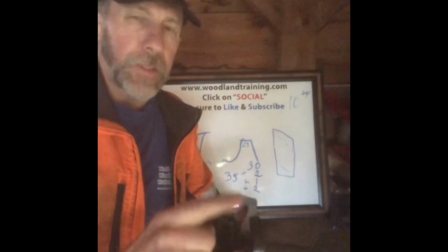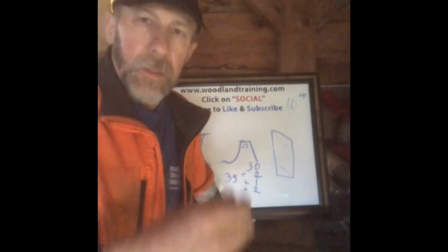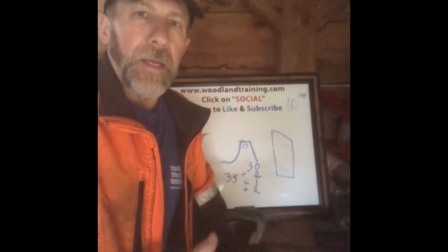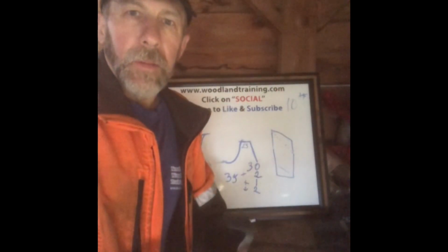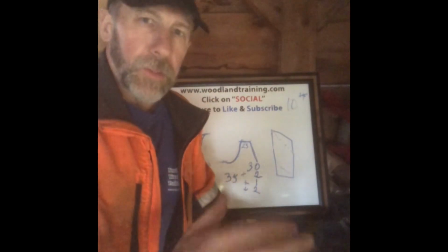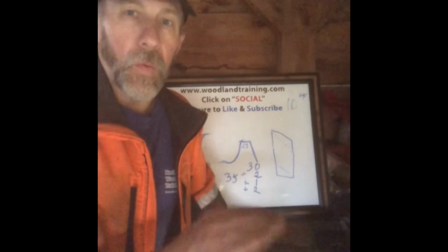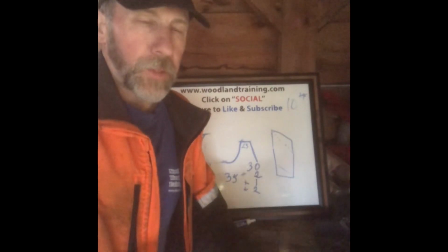So there's a lot of different designs of depth gauges. You know, this is your basic old style. I've got the model here. You've probably seen some of this chain. It's a Vanguard style. There's the double depth gauges and ramped depth gauges. All of that is designed to reduce the power of a kickback. The chain manufacturers, their company lawyers, are just deathly afraid of a lawsuit coming from a kickback caused by their product. So they're trying to use some of these features to reduce the potential of a bad kickback. There is no anti-kickback chain. Doesn't exist. Any chain can kick back. But just wanted to mention that.